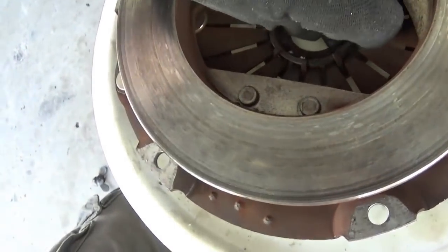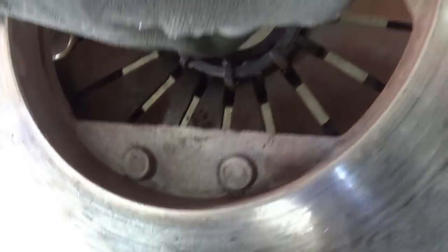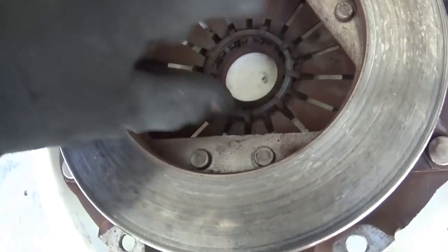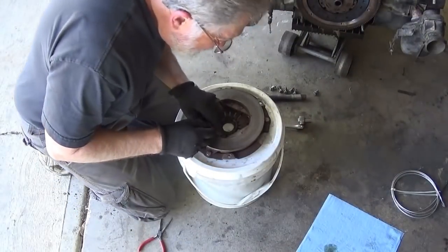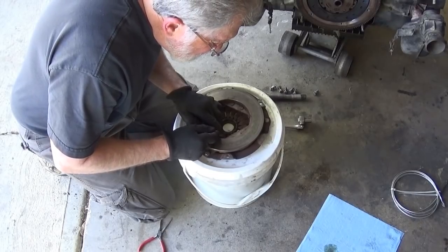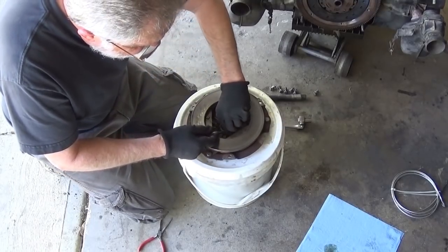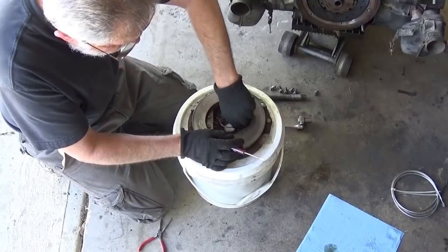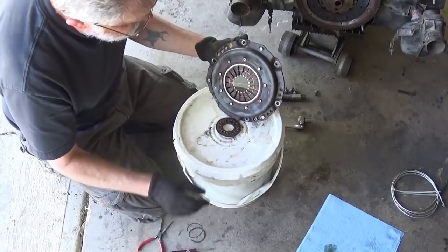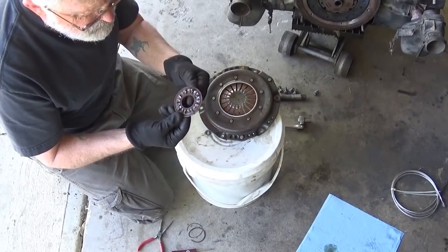And if you can look in there, there is a clip, there is a little spring, this flat spring. I'll be able to lift that back and out and take this whole center section out. There it is. So you take that off, and don't lose that because you may run into one of these where you have a different transmission and this center cone section comes off.